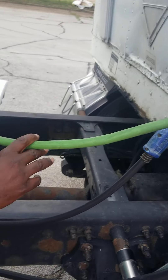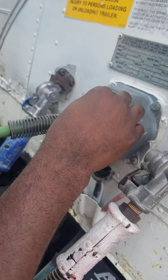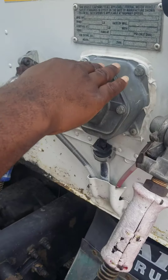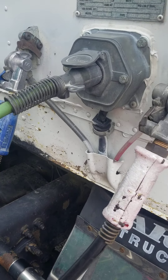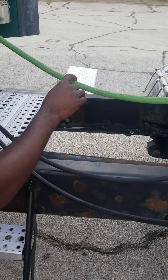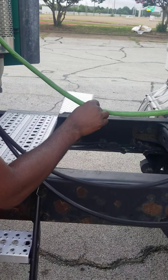This is my electrical line. My electrical line on both ends has spring-loaded locking caps. The spring-loaded locking caps are not missing nuts, bolts, or screws, not being broke or cracked. It's properly mounted and secure. The line is not tangled or spliced. It has no abrasions, bulges, or cuts, not cut, frayed, or torn. It's properly mounted and secure.